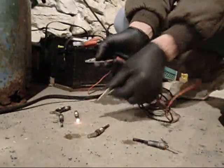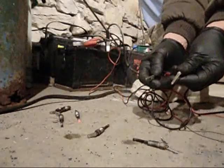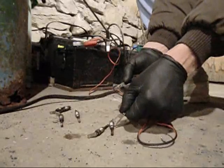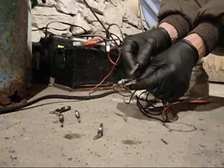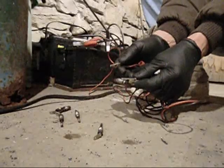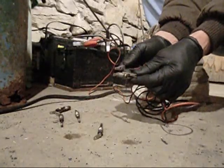Now, they sell a whole bunch of different ones. Wellmans, that SS Diesel, I was just reading on the internet. SS Diesel sells Wellmans that they used in Hummers, and it seems that those may have had, before 2005, a habit of swelling, expanding here, and they don't come out of the hole. That's not a good thing. I guess you just push it into the cylinder, and it rattles around on top of the piston and lowers the compression. I read that.